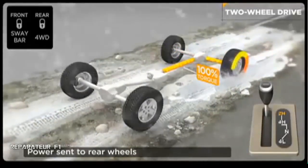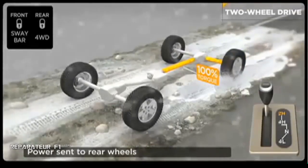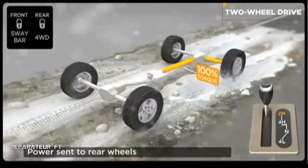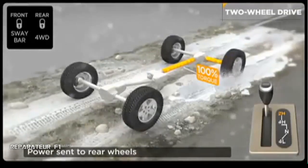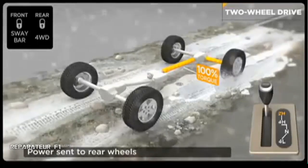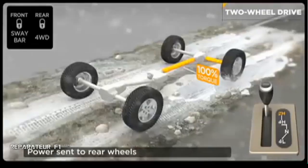In this mode, power is being distributed to one rear wheel while the other stands still. You may have experienced this situation before if your vehicle was stuck with one wheel on ice and the other on hard pavement. In an open differential, the wheel with the least resistance gets all the power and just spins.